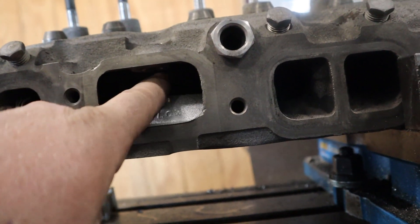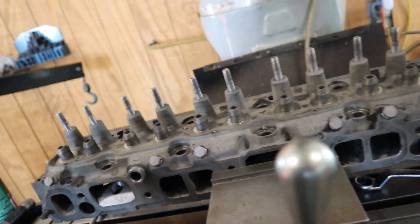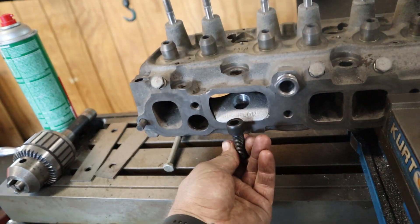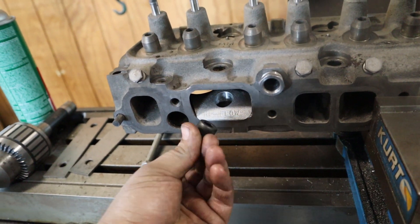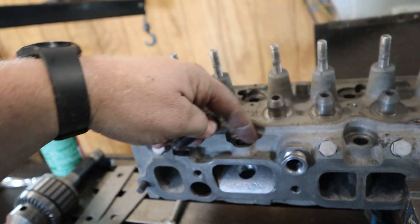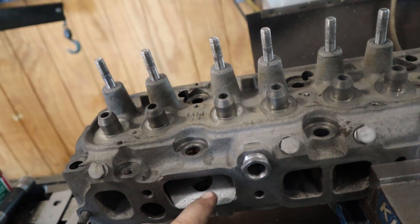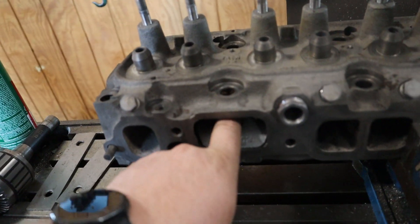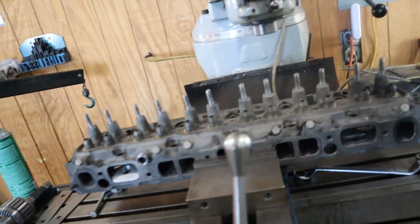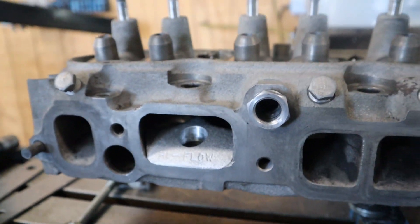All I've got left to do is a little bit of trimming up here — there's a sharp edge. I need to make this bolt work because this is what's going to fasten it down to the block. The bolt has to go in through the top, so I need to cut this out and put a big freeze plug in it so the bolt can drop down into there. Once that's done, I can do some sanding, give it a nice transition. If it looks good, it's going to be good. There's the hard part of the lump installation done.